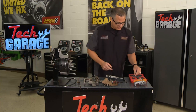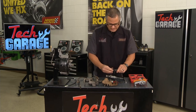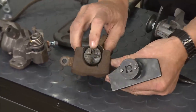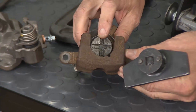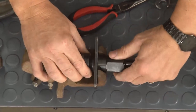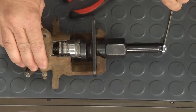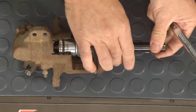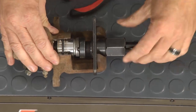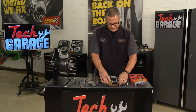What do we do? Real simple — get your tool set like this, and what it does is twist and push at the same time. You can see the little notches on the caliper assembly itself — that's another indication you have an integral parking brake, because they give you the notches to wind it back. I'm going to hold constant pressure on the piston, but to retract it I'm actually going to spin it. Keep pressure on it, spin, keep pressure on it, spin — and it's going back real nice. No problem. Your fluid's going to push it, your e-brake's going to come out, and you won't have smoking on the rear of the car like we had.